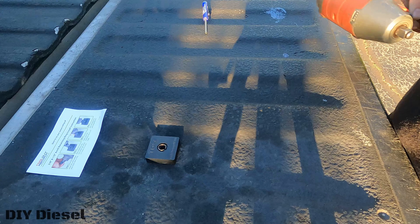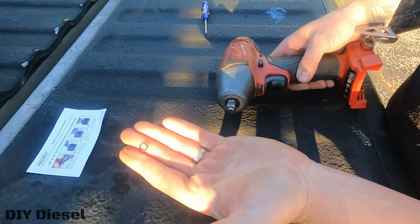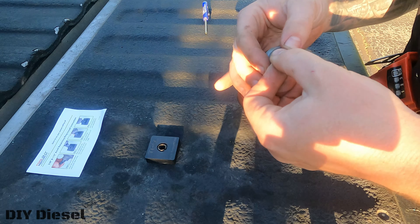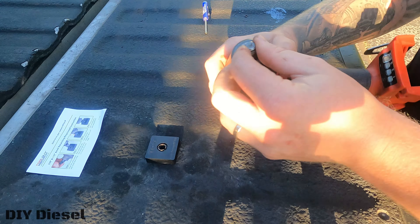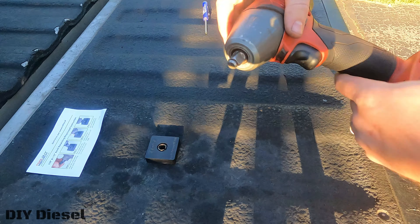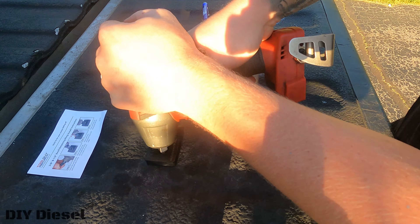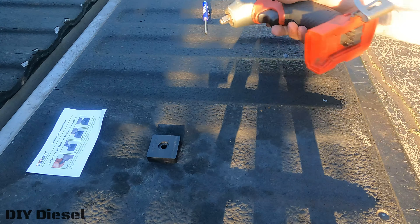You're going to place your snap ring down on the installer tool, then go ahead and put your O-ring on. Once you get your O-ring on, you're going to push the impact down at a 45-degree angle into the installer tool — not straight on, specifically at a 45-degree angle. And it is just that easy.